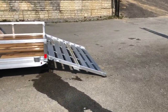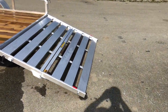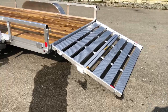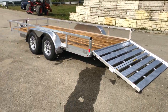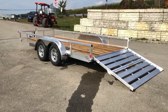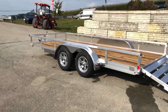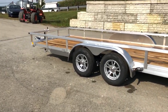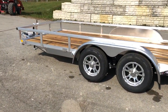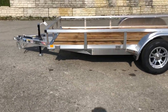Depending on what you're hauling, you may have a two-axle piece of equipment, so you wouldn't have the full 2,000 pounds on the gate. This does come in other sizes. The 7x16 is the most common size and is only available in 7,000 pound tandem axle. We also stock it in a single axle 2,990 pound rated trailer, with common sizes being a 6x10 or 6x12, and it's also available in other sizes and lengths.